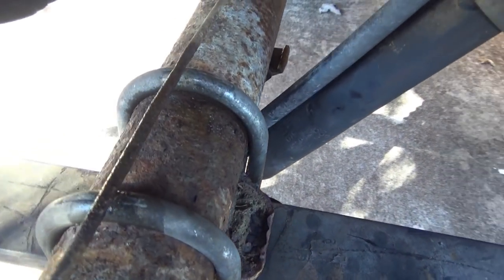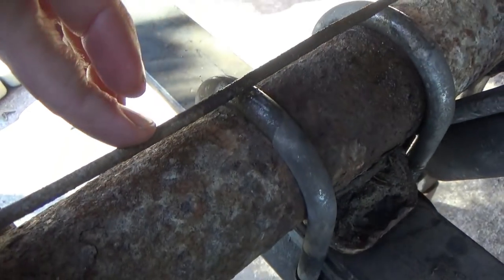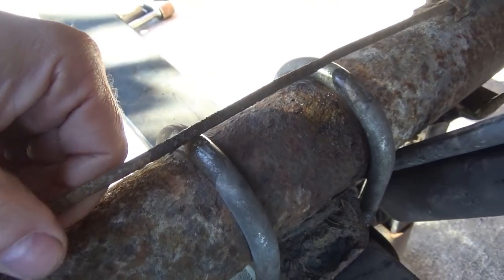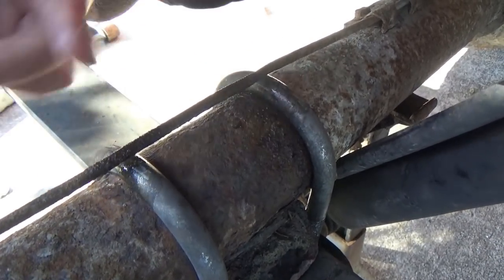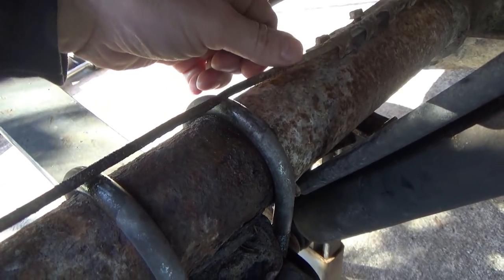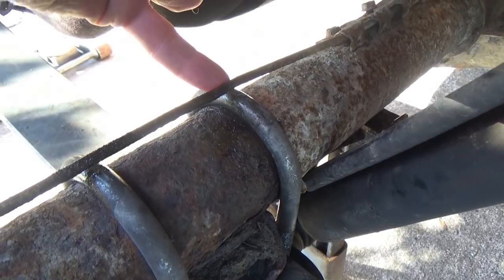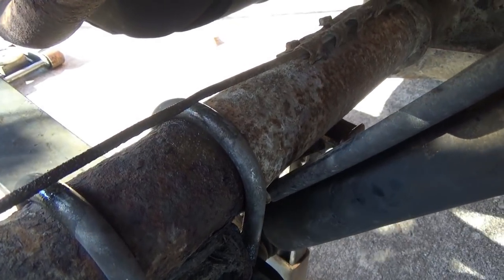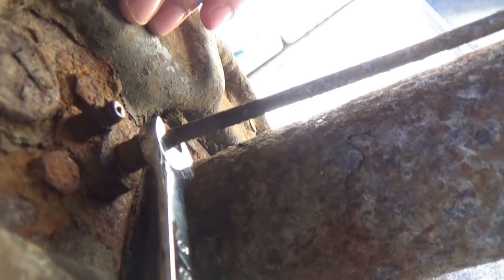Well, I took that for a test drive. That 355 gear set is so much better than the 307s. I didn't like the way these lines looked to begin with because they had that rusty, crusty look on them. But when they were run originally on the Project Rust Bucket, this was not bent up over the U-bolts. So I just took it, as you've seen, to the car wash and thought I was going to wash this rear end off. When I got back and pulled the tire off to check brake lines and stuff, I saw this was wet. My dad pushed the brakes, and sure enough, right at the bottom of that line, I'm shooting fluid. So I'm going to measure that line, see what size it is, and go get another one. Actually, I'll just take the line off and take it with me. It's a smart thing to do. I'll get a 3/8 wrench, and we're going to take these lines off this rear end. Don't worry about losing fluid because we're going to bleed the brakes anyway.